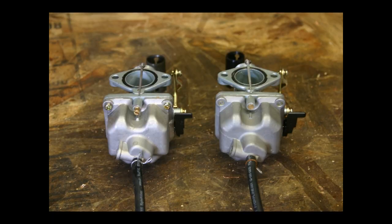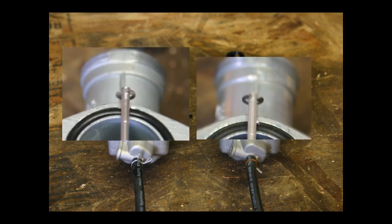Let's examine the difference between the Mudify carburetor on the left and the stock carburetor on the right. The stock carburetor offers no adjustment for the air fuel mix in the idle circuit and you cannot remove the bowl to re-jet your carburetor. The Mudify carburetor allows you access to both of these critical components, as well as giving you an adjustable fuel needle allowing you to change the air fuel mix when the throttle is wide open.